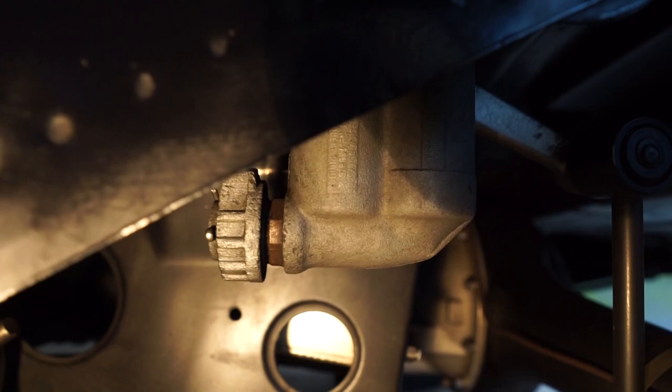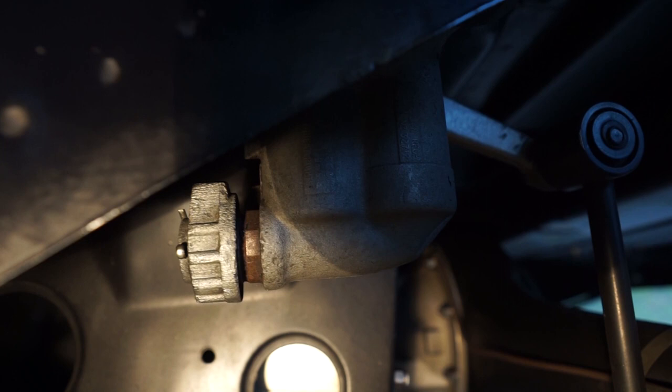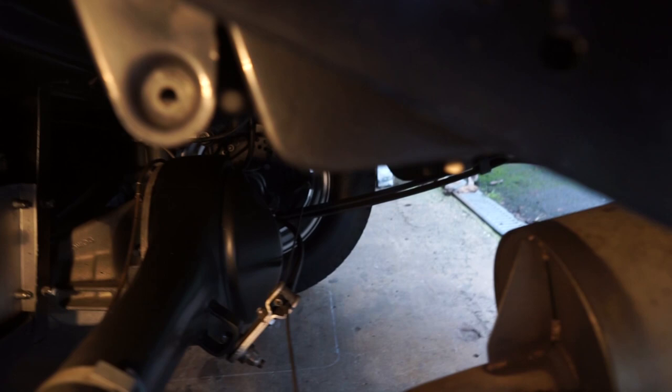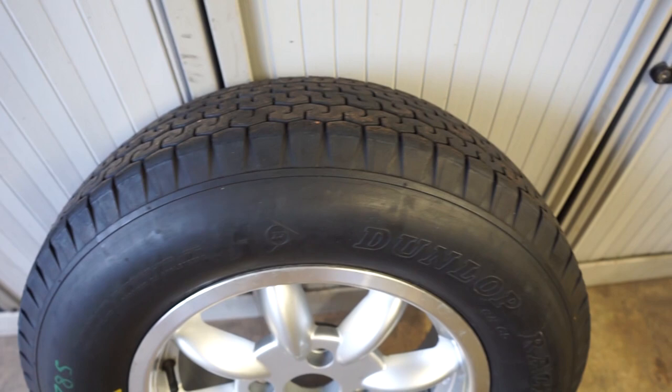You can see the anti-roll bar sitting in a solid aluminium block at the front - it's a 7/8 inch diameter anti-roll bar. At the rear of the car we're using lever arm dampers again, as we're not allowed telescopic type. These are adjustable lever arms with a little knob on the back - you can wind it all the way out for the rain to make it nice and soft, or firm it up for normal circuit racing at about three or four clicks off the maximum. The car has the banjo axle. At the rear we have parabolic springs with just two leaves, making them a little bit lighter.